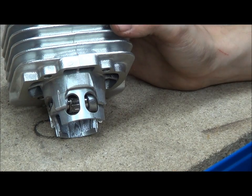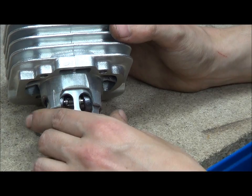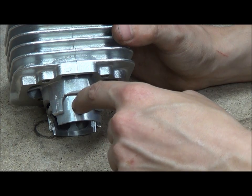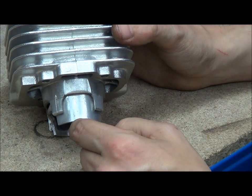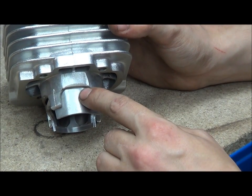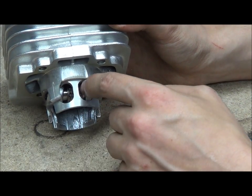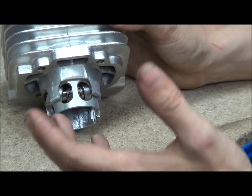I will do a full explanation of this later on — I just wanted to do a quick video to show you. If this piston didn't have any windows and was like this, this part of the inlet port, as it comes past your reeds, through your reeds into your crank casing, will be blocked off by the piston as it descends at bottom dead centre. However, with these windows, you are now opening that up, so the air and fuel can still flow in — it's not been restricted by the piston.